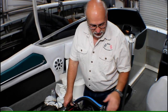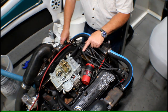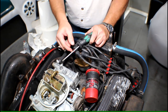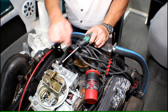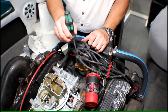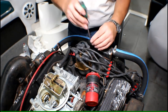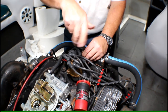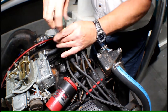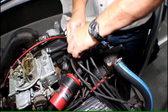The first thing I want to do — cylinder one is over here. I've identified this is the spark plug wire for number one. On these Fords they're usually always right here, number one, pointing at the carburetor. I'll make a mental note where the rotor is pointing once we get in, because we want to put this back the same way. This is the easy way. Number one cylinder is right here, and that's where we want number one to be when we're finished with the new distributor.